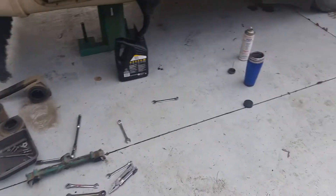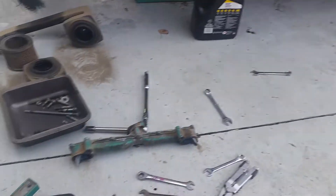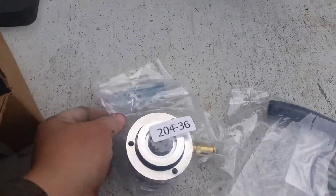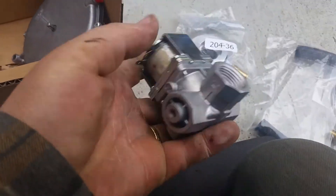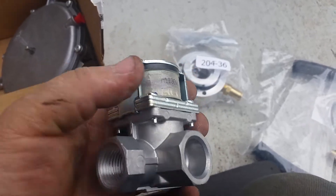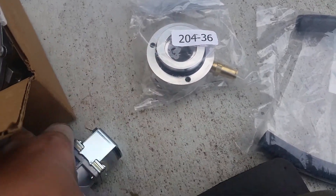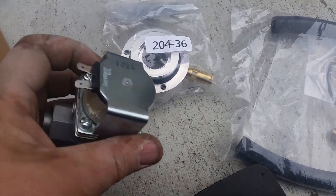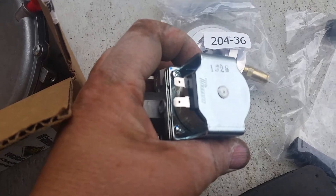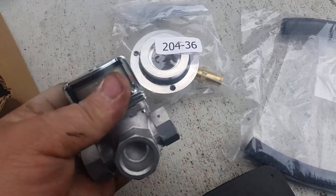What I'm doing today — I'll show you the finished product — but basically this is the kit right here. I'm going to put an inline on/off valve. The reason is I don't trust these draw systems; they say it only sends gas when there's a draw, but I just don't trust those systems. This is a two-wire pull: one goes to ground, one gets positive. Very simple — turns gas on and off.